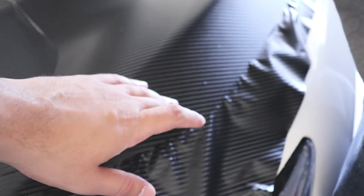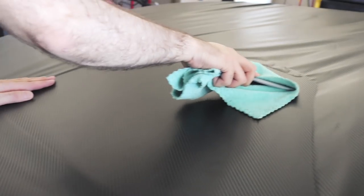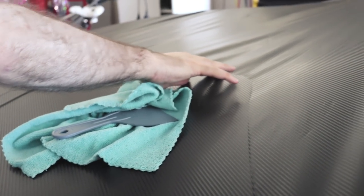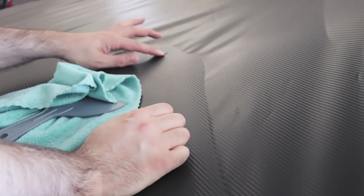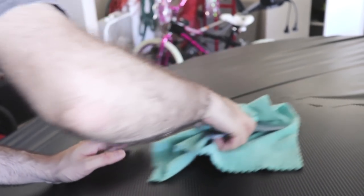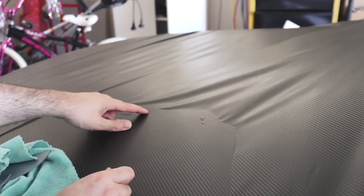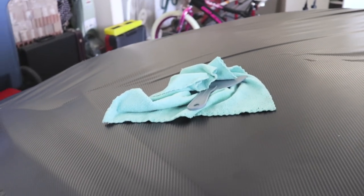We're almost at the end of the hood but we've nearly deformed the vinyl trying to push out these little bubbles and creases. We realized it's actually better to leave some creases in — this whole area was filled with different veins of air, but that works because you keep pushing the little bubbles into bigger veins which gives you an outlet to push the air out. We got through a lot more in the past hour doing it that way. We're hoping the few remaining imperfections will disappear with heat.